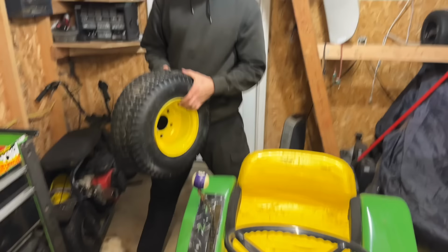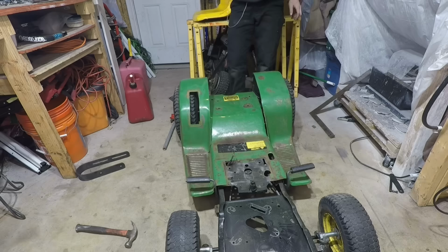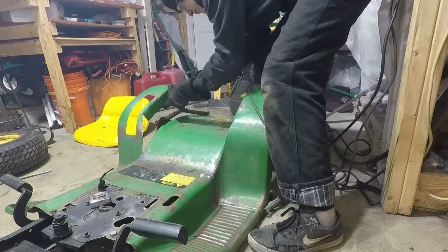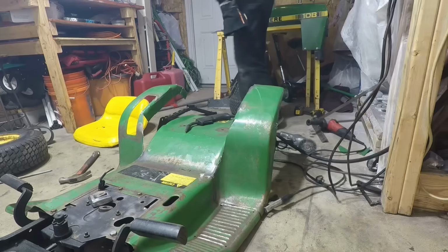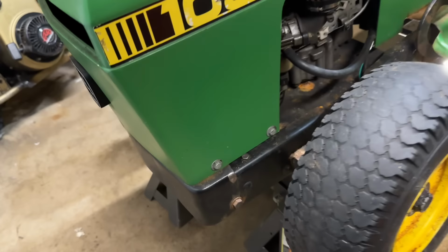As you can tell from the time-lapse video, with the body I just kind of went for it. First, I flipped the wheels so they would stick out further and fit the seat in between. Then I proceeded to cut this piece and fold down the flaps to fit the seat. The most important part to finish the look was that I lowered this control unit and the hood about 2 inches to match the proportions.